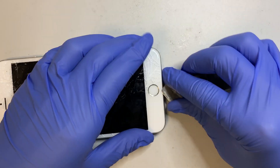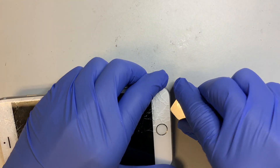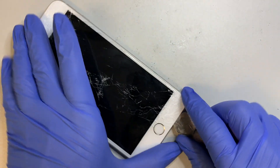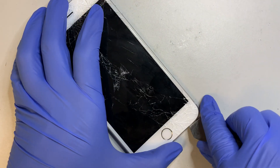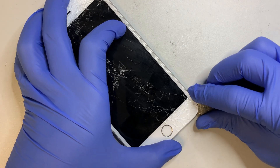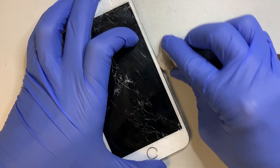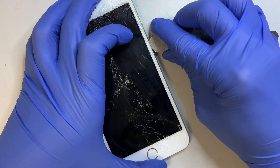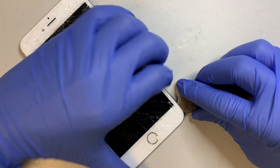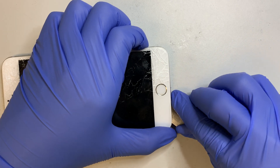This prying tool — what I'm doing is prying open the glass and at the same time cutting the adhesive. There is a double-sided adhesive taped all around the phone and you need to cut it in order to open up the phone. Go ahead and do so by slightly cutting in, and while you're cutting it, slightly pry it open and push it out a little bit.